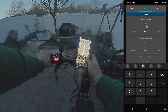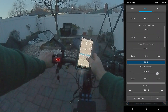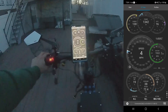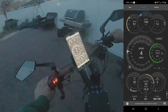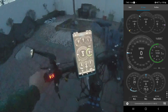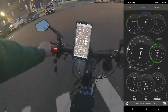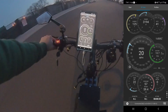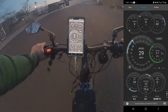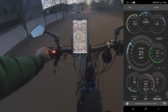Let's set motor current max to 140 or 130. That acceleration is scary, man — let me go for a little test ride. This thing is for sure going to go fast now. Holy f**k — wow. My spokes are experiencing torque they've never experienced. I can hear them popping and crackling.